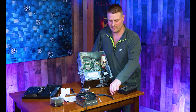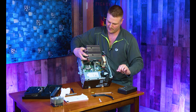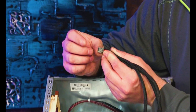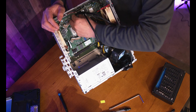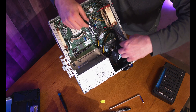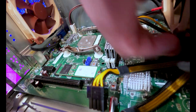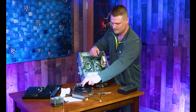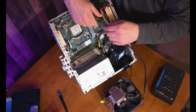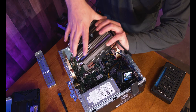This comes with your Noctua install kit — pull it out of the box. But first we need to hook up our other fan. Grab the three-way fan splitter; the tabs go toward the bottom of the case. Find the connector that has four pins — that's your CPU fan header. Hook up your fan on one of the other three-pin connectors, tuck the wires up and out of the way. The industrial fan line is really long; the kit does include an extension if you want to make the install easier.